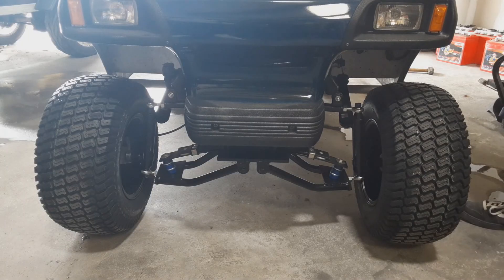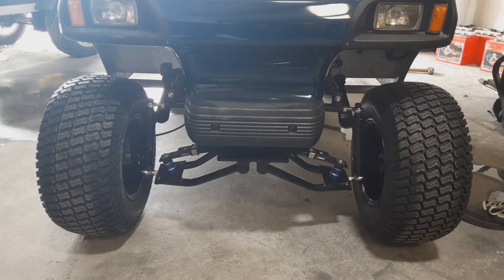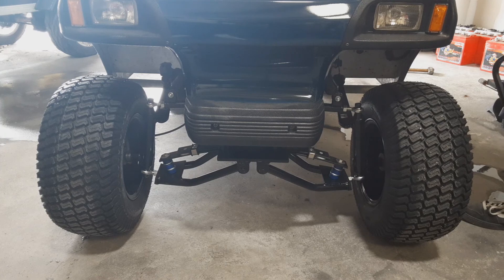When you're working on a Club Car DS and the front end has an alignment issue and one tire appears to be going in another direction as opposed to the other one that looks like it's going straight, don't spend your time trying to adjust that tire. It's actually a mirage. What you want to do is tackle them both together — split the difference.